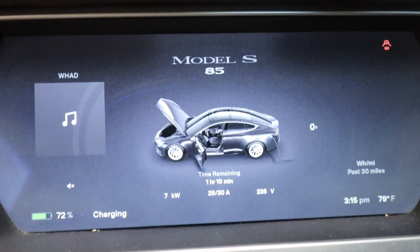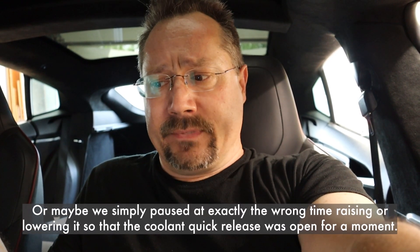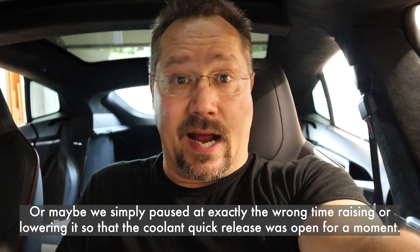We dropped the battery pack and reseated it, and after that it worked — we could plug in the car and have it charge. Right now on the dashboard there are no errors and the car is charging as it should. This is all with the car just temporarily put together since we didn't know if we had the problem solved. The car did leak a bunch of coolant because the front jack wasn't quite all the way up, so the coolant port wasn't fully engaged when the car turned back on — coolant sprayed all over the top of the battery, which is why we had duct-taped all our seams.